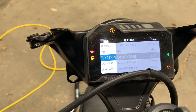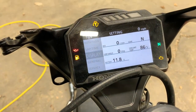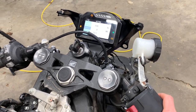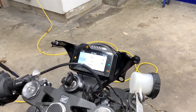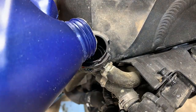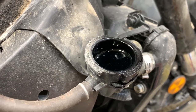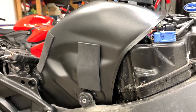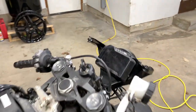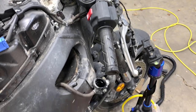Before I ran it too long I stopped the bike because I wanted to find the coolant temp — look at that, it has an auto dimming feature. Coolant is slowly starting to not dribble down anymore. Fuel was the issue — I put new fuel in it, more fuel, and it really primed the pump way better, so it actually fired up. Now I'm going to run it again and see if I can run it for longer. I got it up to about 190 degrees with the coolant but it was rising really fast, so I stopped the bike and put more coolant in. Now let's run it again.